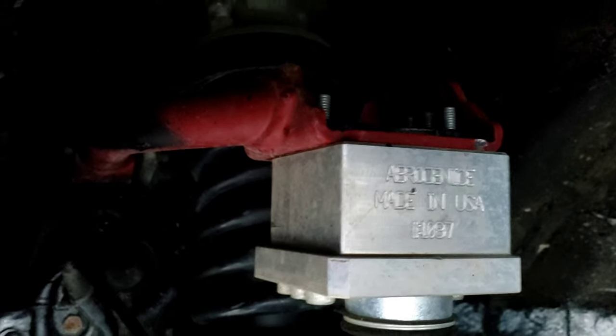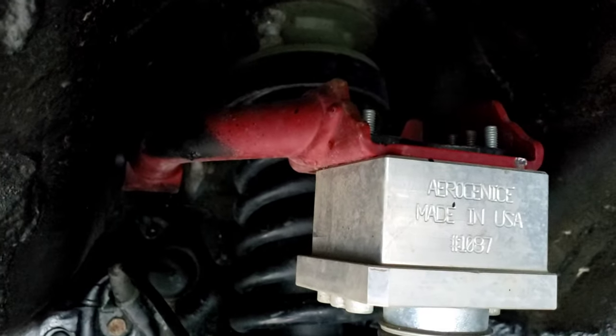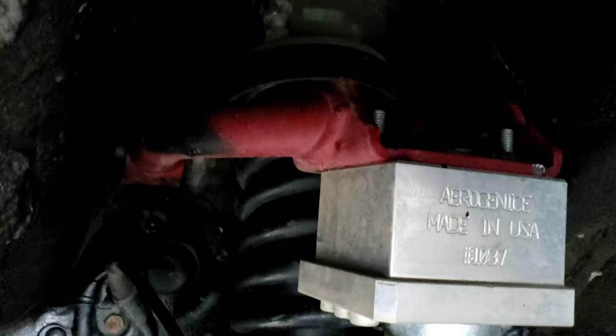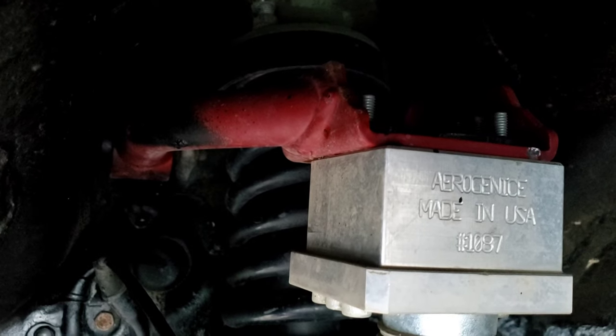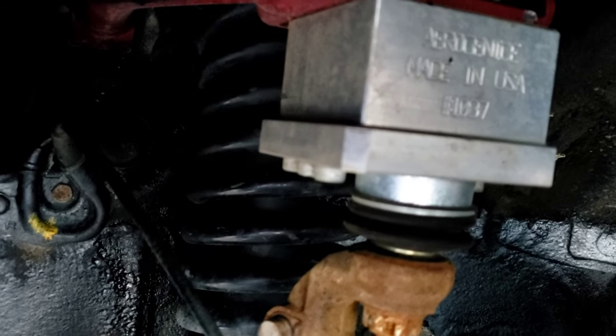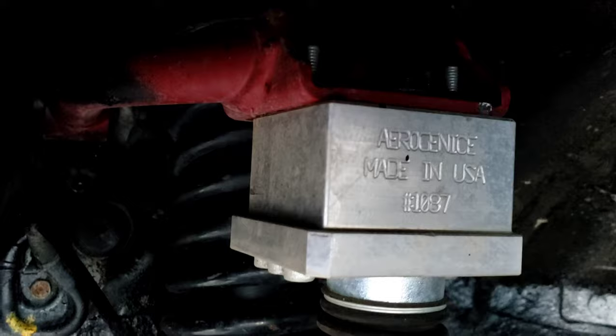Highly recommend, when you're this high, you're going to need to go with the True Heart camber kit and control arm. They do have the lifted style now, which I hear is pretty decent. This high a lift, I'm not quite sure how it acts with the ball joint. To be safe, I wanted the ball joint spacers.